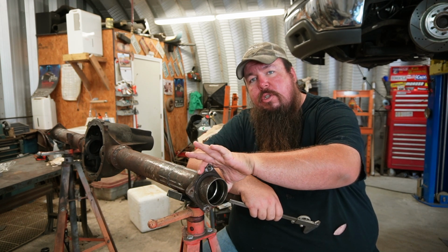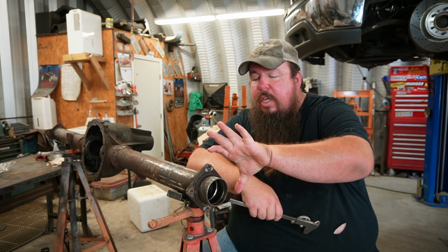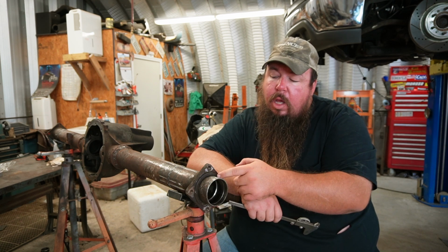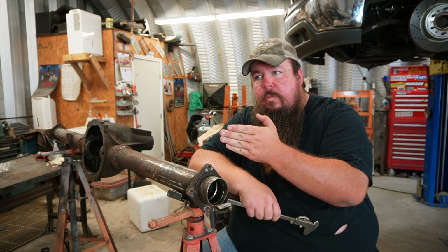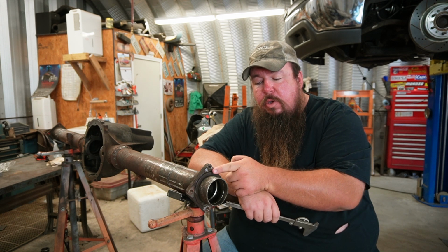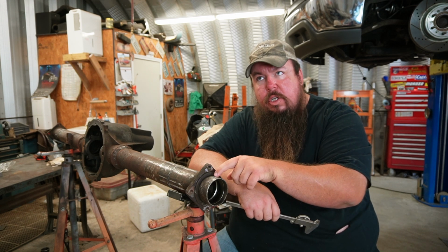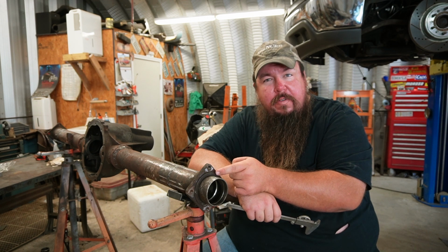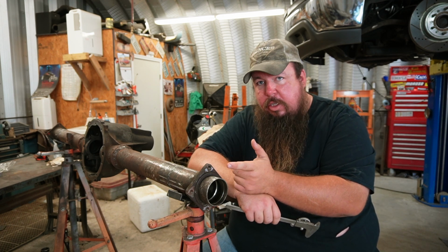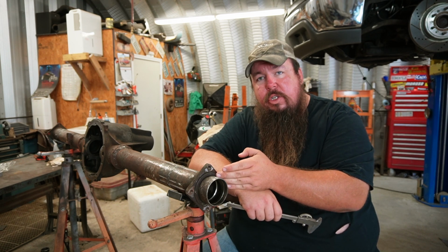This is where the backing plate and stuff bolts up, and just in here is a boss or a ledge that the brake backing plate registers on. It lines up on this little boss right here, and what they want to know is if it's 160 thousandths or smaller boss here, then you move your cut line further up on the end of the housing here. And I believe on the instructions, you cut 125 thousandths away from the boss. Now, if this boss sticks out to like 225 thousandths, then you cut this off flush with the end of the boss on the instructions.